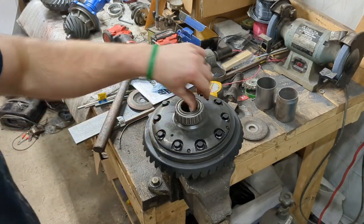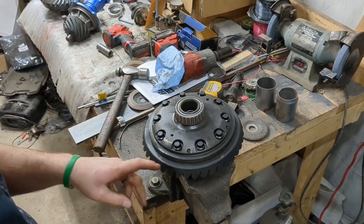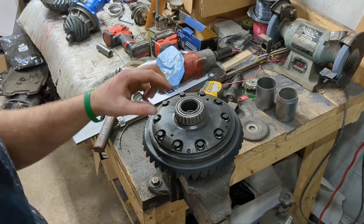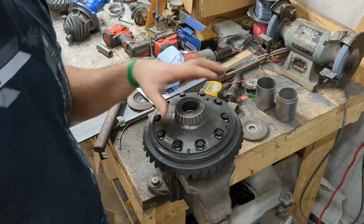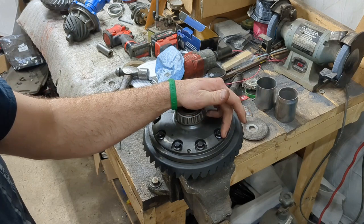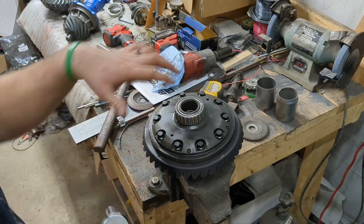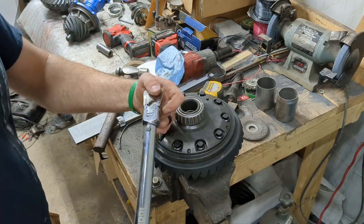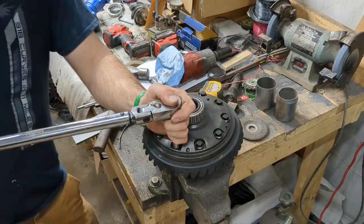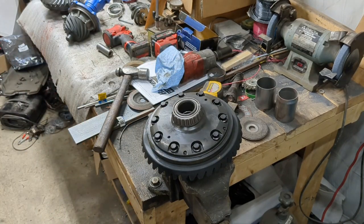Now I've got the carrier gently clamped in the vise. The Detroit locker is so thick compared to the existing spool we had that I wasn't able to reuse the ring gear bolts. Also, with the reliefs cut in here, the bolt heads were awfully big and it was going to be very difficult to get a socket on them. So I went ahead and got these ARP 2000 bolts — they're 7/16 by 20 and I believe these were inch-and-a-quarter long. I'm not using the washers that were included; we're just going to torque them down at 65 foot-pounds, just as the spec says. Now our ring gear is good to go.